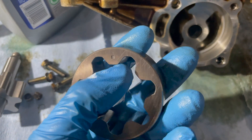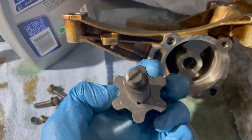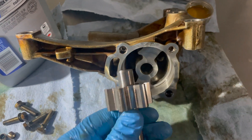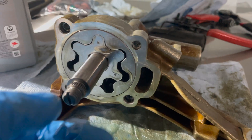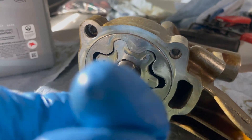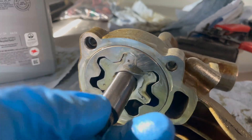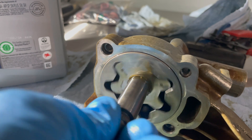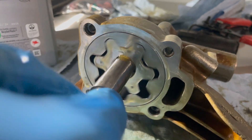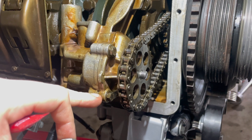The broach goes towards the inside of this housing, and the new one has three broaches. It's going to slide right in — this only goes in one way, so keep that in mind. Once you've put it all back together, make sure you lubricate it and spin it by hand to make sure nothing is holding it back. I know some people have installed the Achilles upgraded stuff and actually had problems with this, so just make sure everything is good to go and it spins freely.